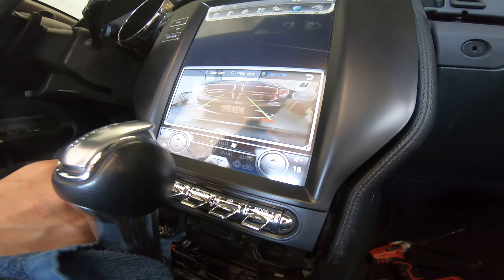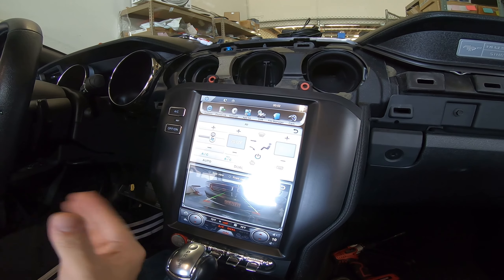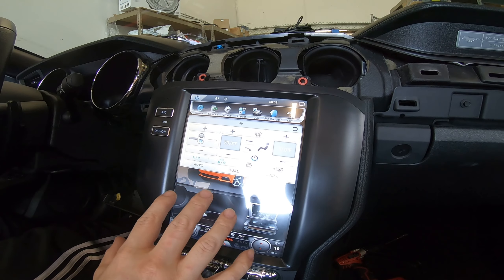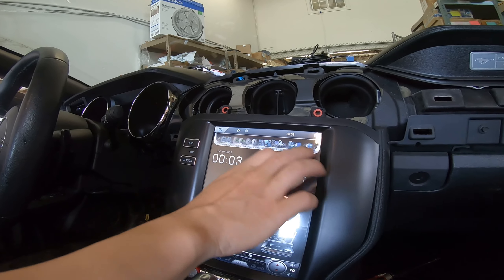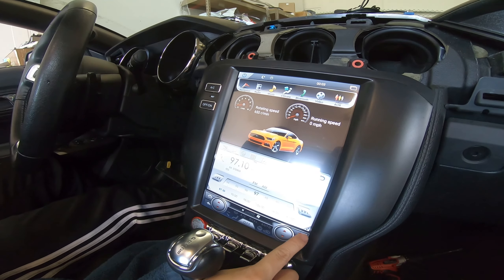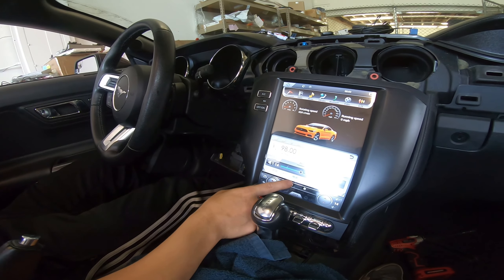The camera is showing. Let's check if the AC controls are working — those two plugs at the bottom. Air conditioning is turning on. Let's check the fan speed. On initial setup, you do want to leave your car running for a while so the unit and the car can speak to each other and get settings fully done. If we go lower in temperature, it goes to about 66. The reason it's a little laggy is because we just installed the unit and it needs to read the car — let it run for a while and talk to each other. Let's check radio, see if we have sound. That's radio sound — let's go to 97.1. We do have sound. Let's check if the steering wheel controls work: volume up — I press up, it goes up; go down — I go down. Next track will go to the next radio station.